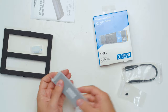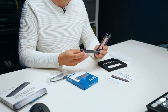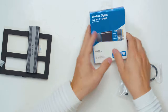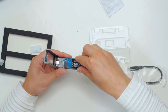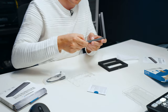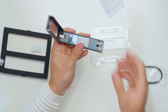We get this enclosure, slide this part out, pop the button on the side — it just pops open like that. Look how simple this is. We take our M.2 drive, open up the packaging, and pop it in there. We push it down and make sure the rubber goes underneath, and the rubber holds the SSD down — just like that.